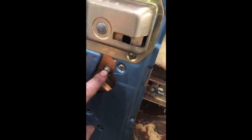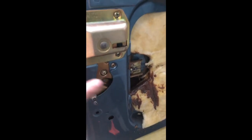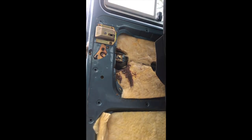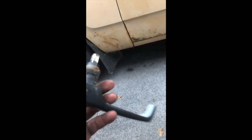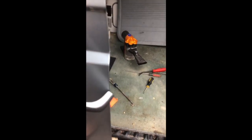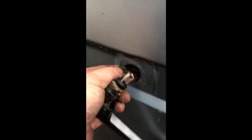What we're doing today is pulling this screw off which holds the exterior doorknob on. That way we can get the key code off it so we can have keys made for this car. That screw is usually loctited on pretty good because it tends to come loose. And then the door handle pulls straight out. If we look at this, we can see that this seal — there would have been a soft neoprene seal that goes around it. That's all ruined. And there's a bezel seal that goes in here on the outside of the body. That is also pretty thoroughly ruined. So we need another one of all of that.